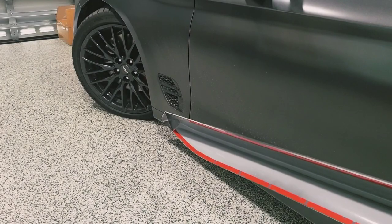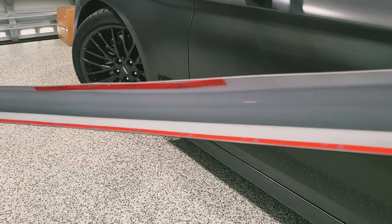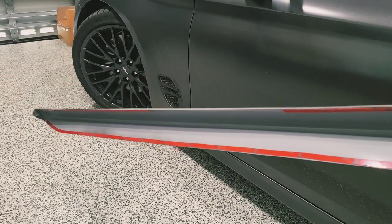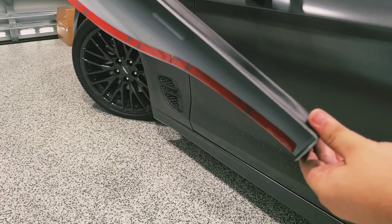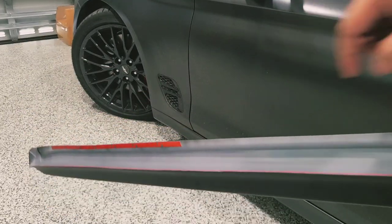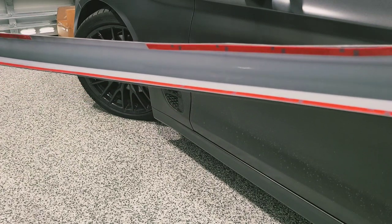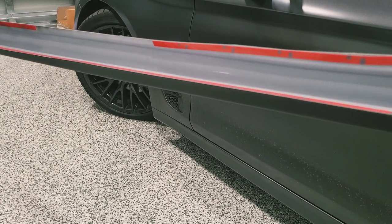Here's the side skirt. On the bottom area you're only going to do three long strips, like so. The part that goes on the top area is going to be fully covered with 3M all the way to the end. What I like to do is peel the ones on the bottom first, which gives me enough leverage to position the side skirt. If you're working alone, on the top one just rip enough from one corner to halfway and leave the ribbon sticking out — I'll show you that now.